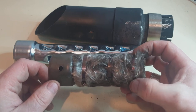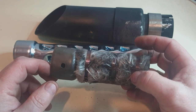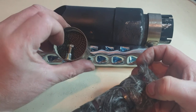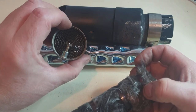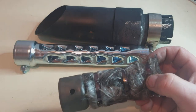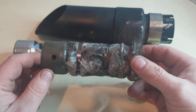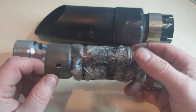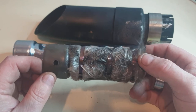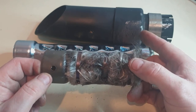My apologies that I haven't got any sound comparisons — no comparison between straight through, the Radiant baffle, or the universal baffle. I might do that when I put it back on after the MOT. But I can tell you that after doing all this and putting the baffling in, I was a lot happier with the sound. It just muffles the tinniness, so you get a really nice low grumble — it's barky still, but you don't get that raspy tinniness from just the Radiant itself.